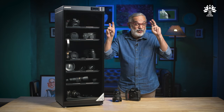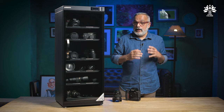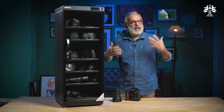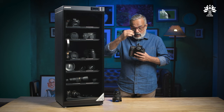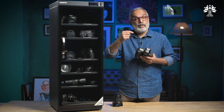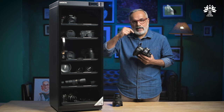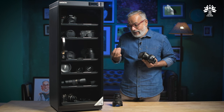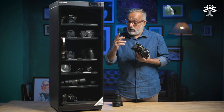Keeping your camera inside a dry cabinet alone won't guarantee protection from destruction. You need to take care of the camera while it's outside as well. We work in tropical conditions — heat, humid environments — and we start sweating. Sweat can drip onto the camera, and even if it's weather-shielded, it seeps in over time through all the crevices, openings, and joints. Sweat has salt and acids in it, which are corrosive and over time start eating into the camera body.